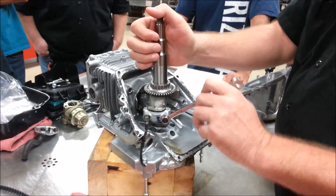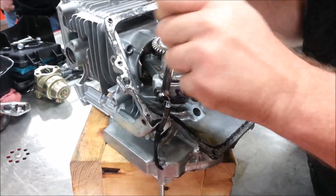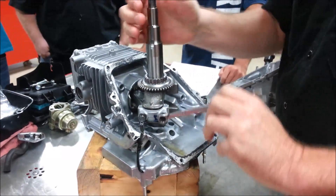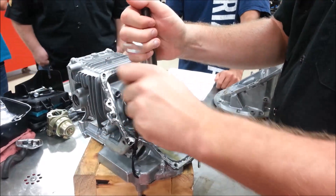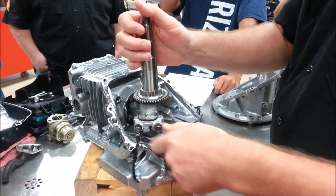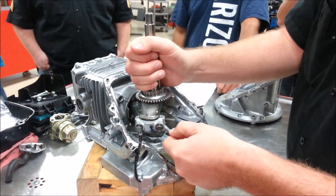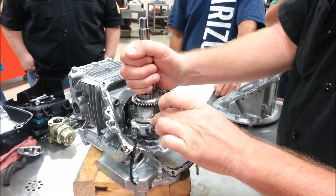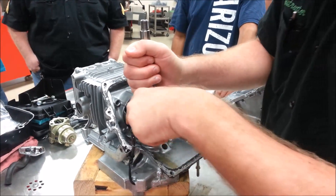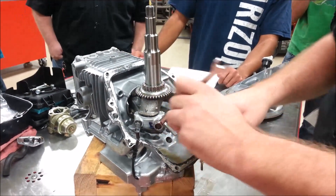On the rod itself, these are six-by-one millimeter bolts, so about what's their torque? Six to nine foot-pounds. What you can do is just wiggle this. I do not want to intentionally try to grab this — if I put leverage here while it's still stuck, I will break that arm off. So I'm just going to put a little pressure on here. Can you see the gap in it now? It has loosened up enough to where it's going to be free.